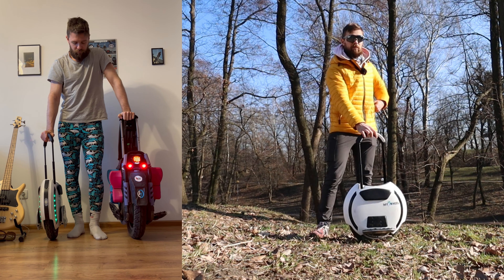The sixth thing is that smaller EUCs have so much less torque than their bigger counterparts. The problem isn't just slower acceleration or lower top speed — it's that sometimes while riding at 15 or 20 kilometers per hour and you hit a bump, it overpowers. That's not a nice feeling, and it applies particularly to heavier riders. If you're over 70 or 80 kilograms, you have to ride a lot more carefully on smaller wheels. This applies to braking too — it's much easier to overpower a small wheel when braking than a big one.